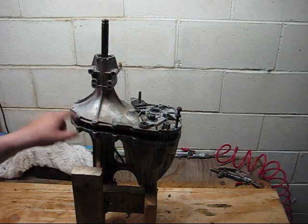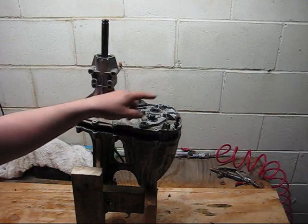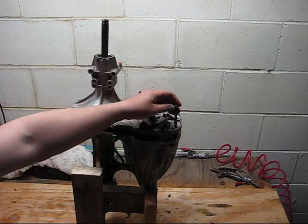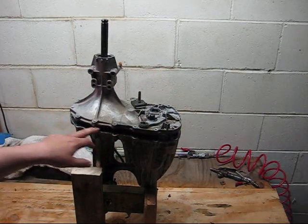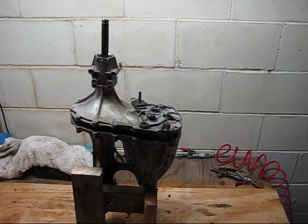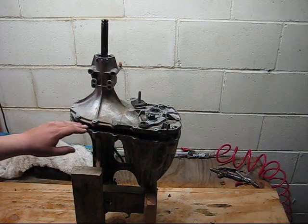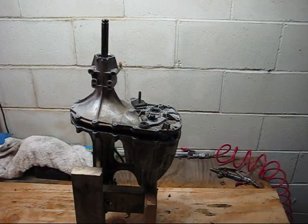There are the case bolts which come out. There's quite a few of those. Make sure you have all of them out so you're not prying on it and there's still a bolt left. And then there's this stud that goes down in here, and everything comes out. There's just sealant, there's no gasket. So when you go to open it up, be careful because they don't have any pry points. So you kind of have to put something thin in there, start a spot, and then gently work around it till it just pops loose.